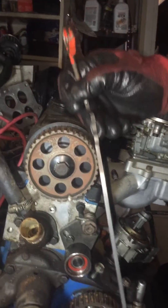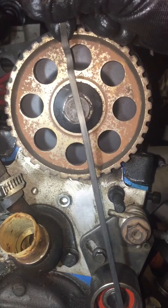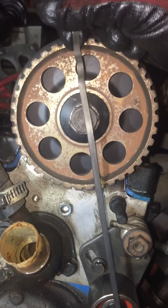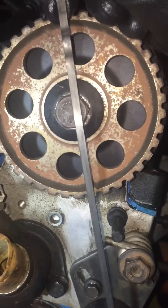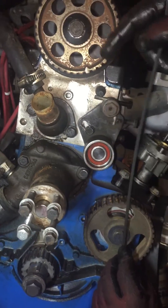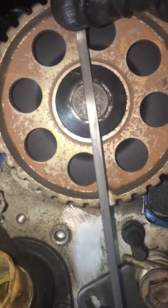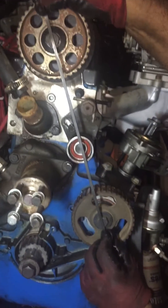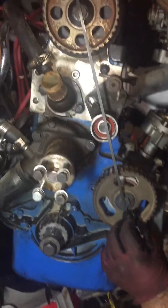What you're going to do is place your dipstick in between the center of your cam gear bolt and your auxiliary shaft bolt. As you can see when you place this in between your bolt here and in between the bolt on your auxiliary shaft bolt, that mark here should be directly behind the dipstick. If it's directly behind the dipstick, then you have it in the correct position for your camshaft to set your timing. That is step two in setting your timing.